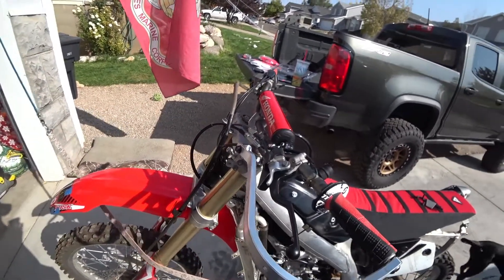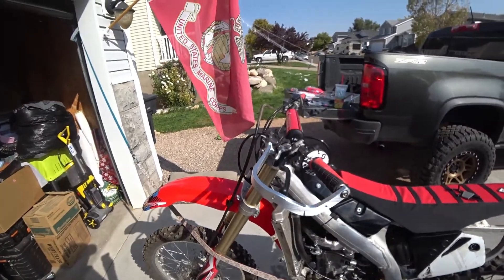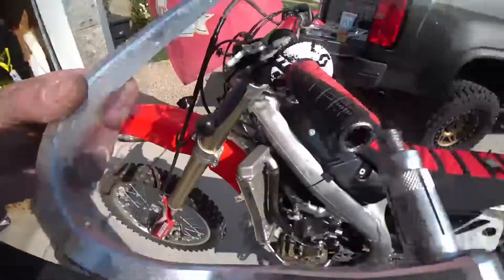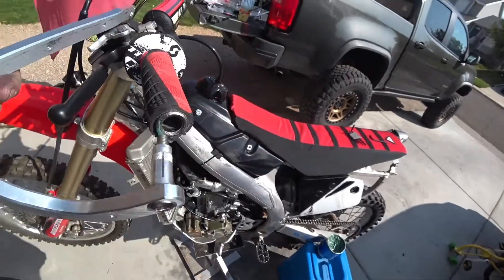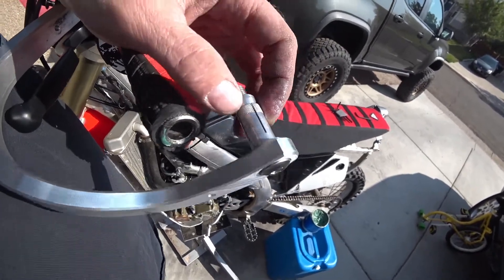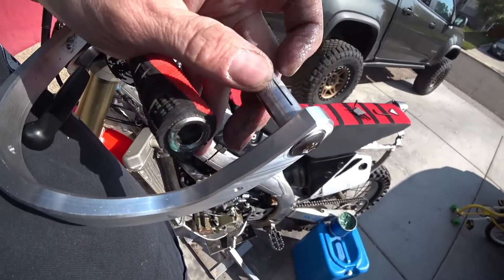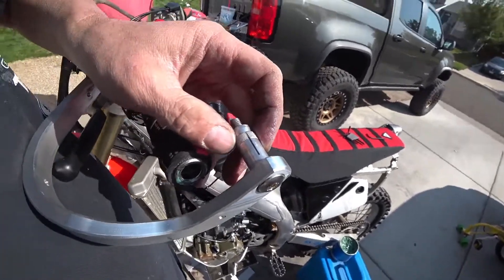These are much more difficult to put on a dual-sport bike with all the extra hardware that goes on a dual-sport. Also of note: you're going to want to have that little nut snug into the knurled section fairly tight as you put the bar in, otherwise it's not going to make that area expand into the handlebar itself.